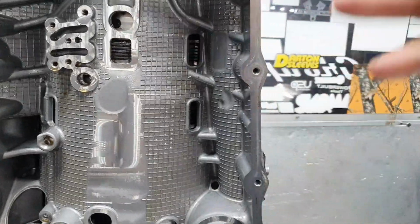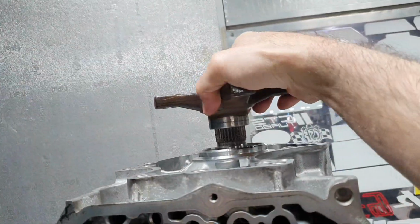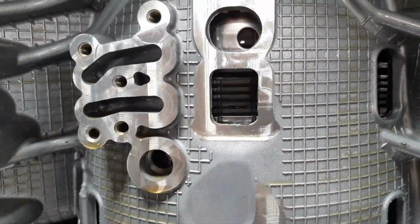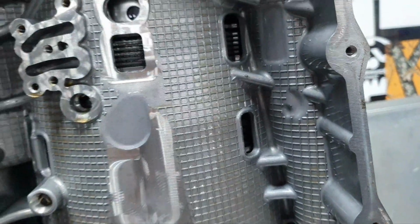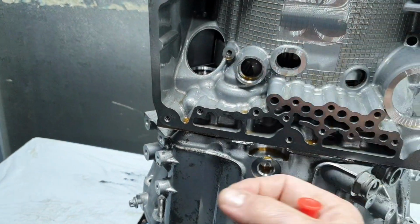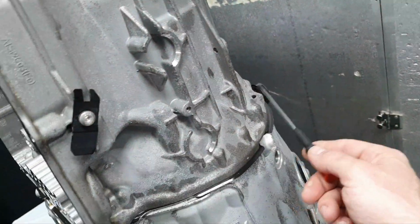I'm taking my time with the housing. Why? First of all, I'm getting one yoke. All right, I'm putting it here, to be able to move it left and right. And then you come here and you see that all the clutches have engagement, and the steel plates are moving up and down like this, and the same thing here. That means it's centered inside and everything's in place. It's aligned properly here. It closes the o-ring for the oil pump with a small spacer. It went already in place. We're looking good. Let's put the 2 bolts now here, removing the yoke, no need anymore, and continue.